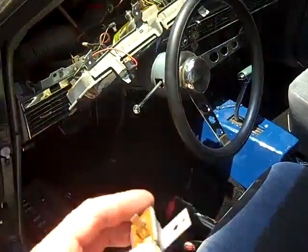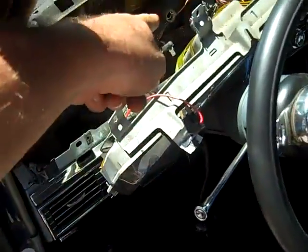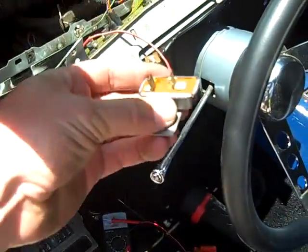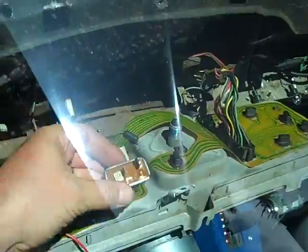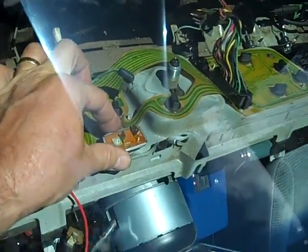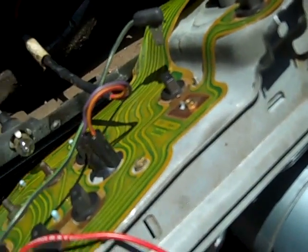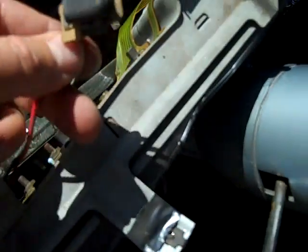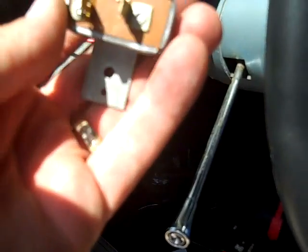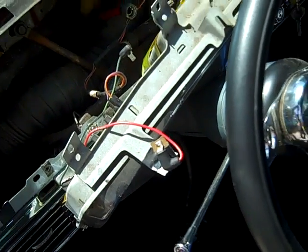Here's the old one. I had to remove the dash pad and then the dash, unscrew the speedometer cable, and the voltage regulator was behind the dash right up at the top. It will be in the back behind there. Here's the positive wire with a little choke on it, and then the negative wire. We're going to replace this with the 7805A, an IC chip, and a small cap.